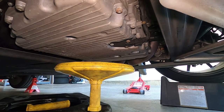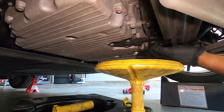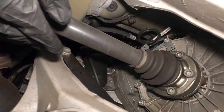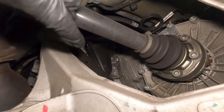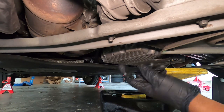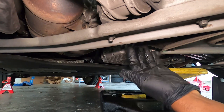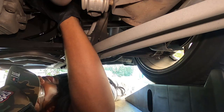This is the old drain plug that we need to remove using that 8 millimeter hex, so I'll go ahead and unscrew that. Here is the filter — it's located on the driver's side, a little bit to the left of the oil pan, kind of next to the header section here. You can see that the oil filter is right there. The way you access it is from the bottom right here. I'm going to put a long extension and use that tool to remove the oil filter. It gets messy because the location is not easily accessible, and I'm not sure why Porsche decided to put the filter down there. It is going to be messy.